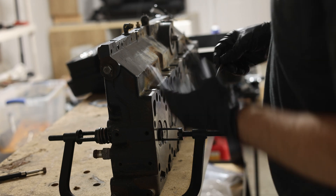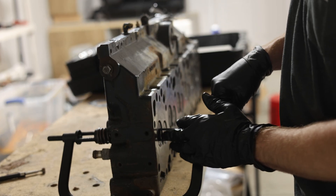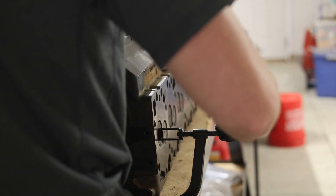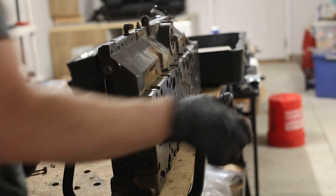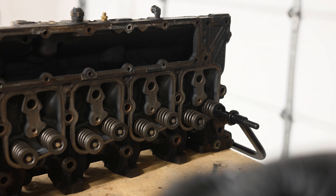Now we're going to be getting into our head. This head has a couple of cracks in the injector ports, which I'll show you in a second. For right now, what we're doing is taking a valve spring compressor and pushing up against the face of the valve and the valve spring with the valve spring compressor. This would be a good time to use protective eyewear — I don't know where mine's at. We're just trying to get this tight enough to where we can get the keepers out. One went flying, so I'm going to go find that. My spring compressor tool wasn't seated correctly on the retainer, and at least one of the keepers shot off.